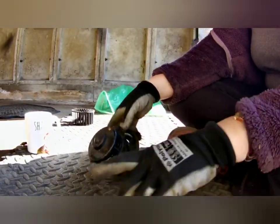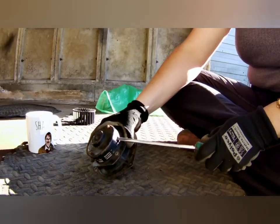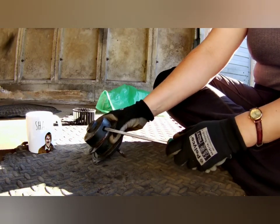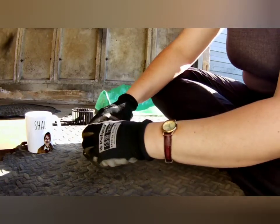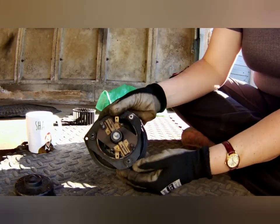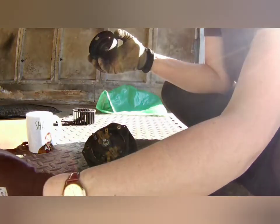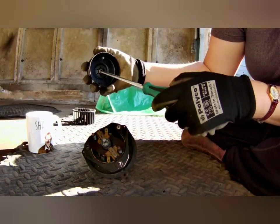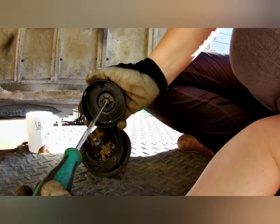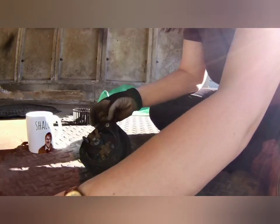Now we want to take that back cover off, but it's normally seized. Get a screwdriver and just give it a little like that - that should be enough to pull it off. There - covers off. That reveals the brushes. Little carbon fibre brushes that brush against - I believe - a copper surface. Now in there is a little ball bearing. Look out for the little washers, keep them. In there is a little round metal ball encased in there. See, that's turning lovely - that's a good one. I would just grease that up, I wouldn't take it out. Happy days, that's ready to roll.